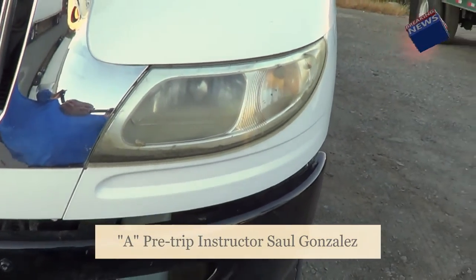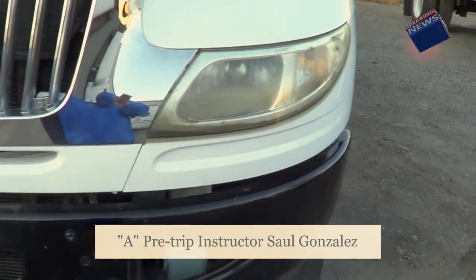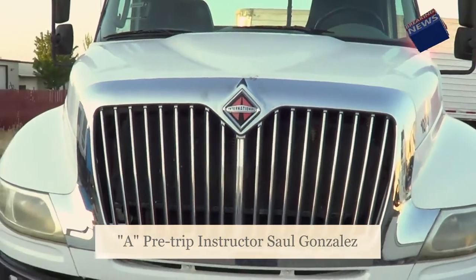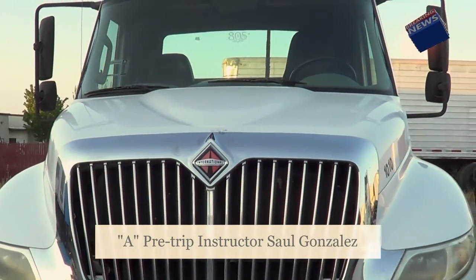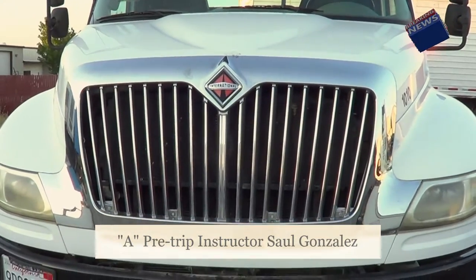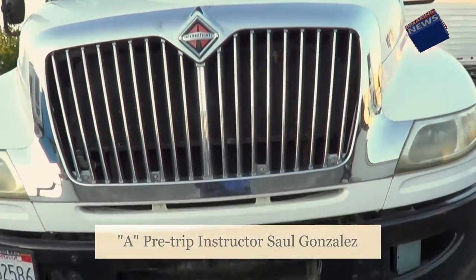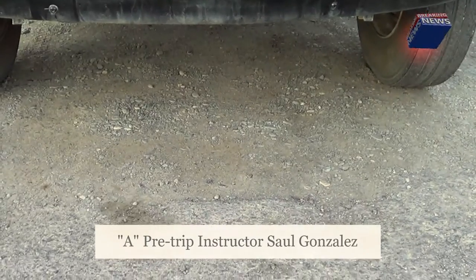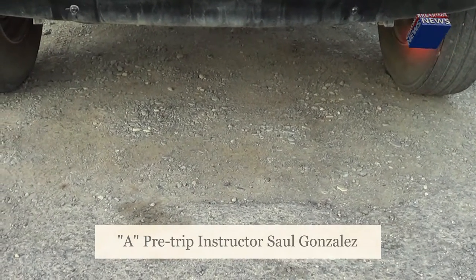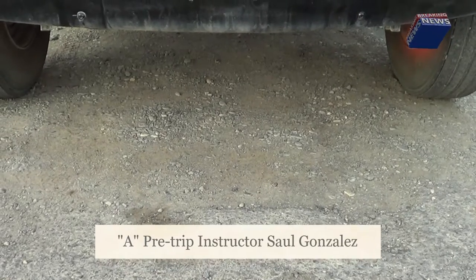The amber lights are not cracked or broken, securely mounted, no missing hardware. I'm going to look at my vehicle and make sure there's no leaning to either side, which would indicate a suspension problem — it could be a flat tire, leaf spring failure, or a shifting load. I'm going to look under my vehicle to make sure there are no puddles indicating any type of fluid leak, and no hanging hoses or hanging wires.